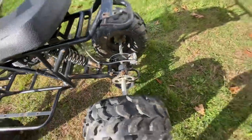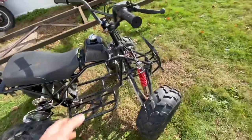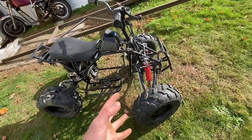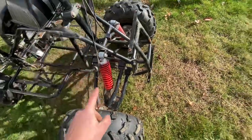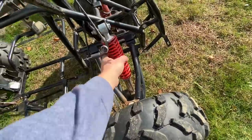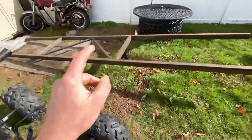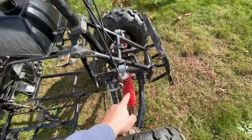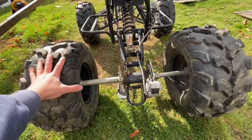This thing seriously has it all — it's got hydraulic rear brakes that work really well. We rolled it and hit it and that thing stopped real quick. It's got front drum brakes, which we'll see about those. The components we're going to be using for this thing as of right now — 100% the upper and lower control arms and suspension components. I'm going to see if I can find aftermarket shocks and springs that are a little stiffer, since this build is gonna be pretty heavy. Probably also going to be using the steering linkage and the rear axle.